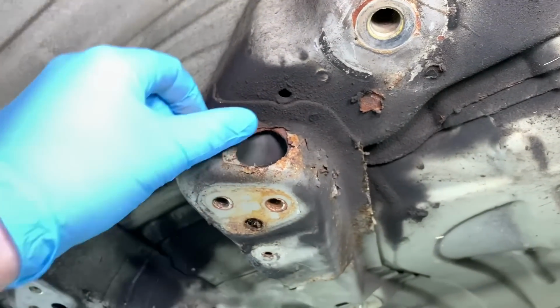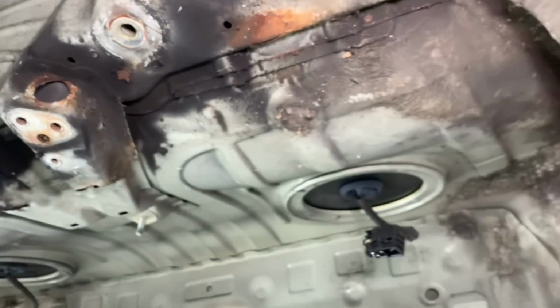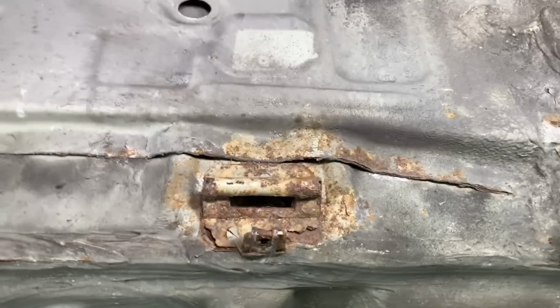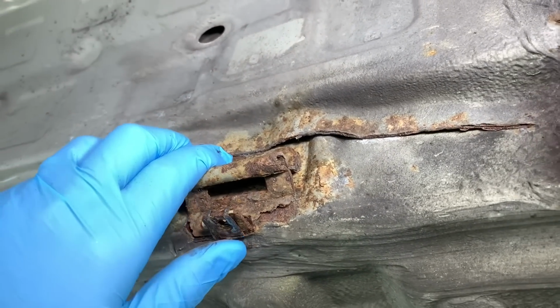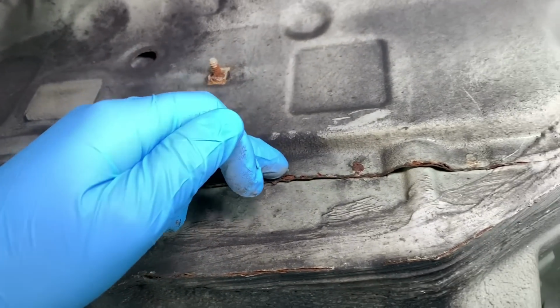And then you get the handbrake console where the E-coat is failing and all that needs taking off and renewing. Same to the front fuel tank brackets. These ones are pretty hanging as well, so they'll be coming off because those ones just are trapping a nice bit of corrosion. We've also got a lot of corrosion sort of on the edges of panel overlaps.